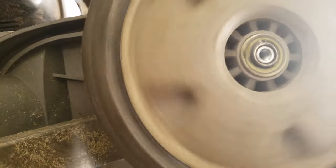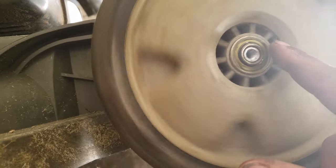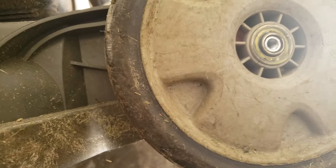If you heard it from the beginning, you heard how it was all squeaking. Now that it's sucking the grease in and lubricating the bearing, the rotation got real smooth and quiet. If I didn't have this camera I would put my finger there and force it in quicker, but it'll lubricate the bearing, extending the life of the wheel bearings so you don't have to replace them.